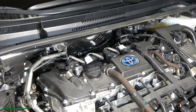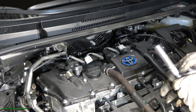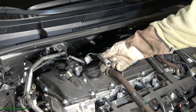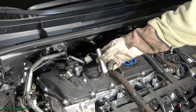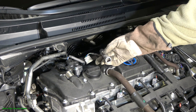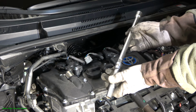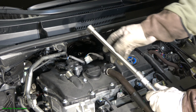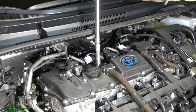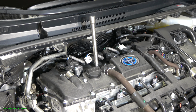And this job starts so that firstly we have taken out these ignition coils, and then we need some specific tools. We have to purchase this 14 millimeter longer spark plug socket, and then we might need this connector, because we need a long extension. These spark plugs, this length is about 1 foot, 30 centimeters. And look, this goes nicely in there, very nicely in this position.